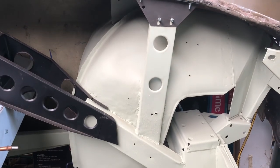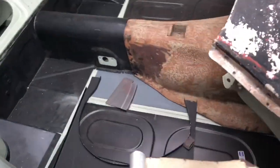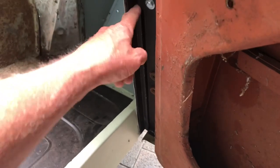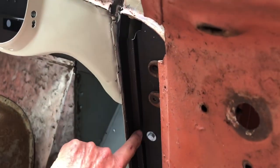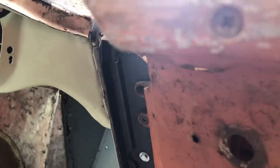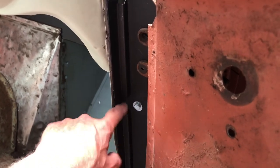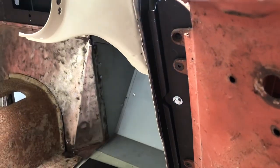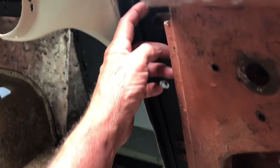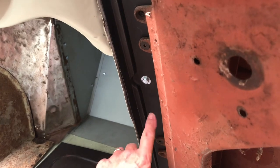The bad one was here — you can see what happened. The windscreen comes up here, and this hinge plate here has got this recessed section for the door strap. Of course all the water builds up in there and it rusted up. This was all rusted out here. So it must have got a bit of dirt down here, blocked it out, and there's not much opportunity to drain very well there either. Because it's — so this had rusted. So I've put new ones on. I haven't fixed them yet, they're just in place. They probably don't need to be fixed — they've got a very strong support behind there. And of course the doors and this is the hinge plate — they were spot welded.